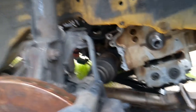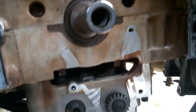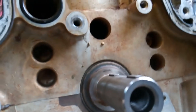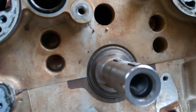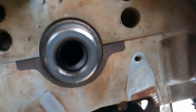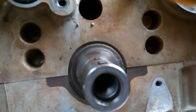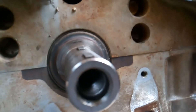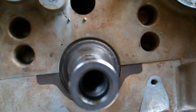I'm going to put you in my little homemade camera holder here. The first thing you're going to want to do when reinstalling this chain is make sure that your crankshaft is lined up accordingly. If you see that little dot underneath that porthole right there, that's going to be your mark on the engine block to line everything up to TDC — top dead center. You're going to want to do that by lining up the keyway on your crankshaft with that dot to the best of your ability. You can get a socket that'll kind of fit on the end of this and catch those keyways, or you could reinstall your bolt and just simply turn it and line everything up.